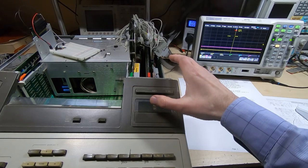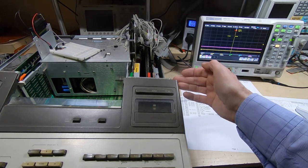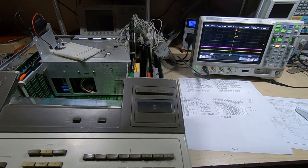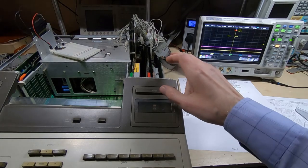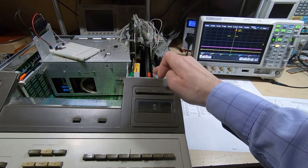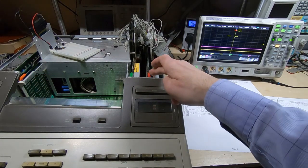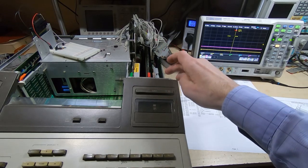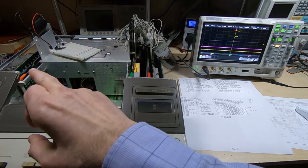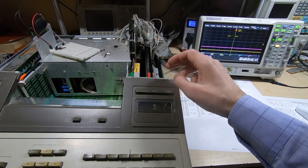In this video we'll see what is going on and try to figure out exactly what's causing the boot failure. There are other faults I know about, but none that should stop the system from at least initially going through the boot-up phase. Just to recap on the way this machine boots up: we have the two processors, the LPU on the right and the PPU on the left. Each has its own ROM and RAM card, but during the initial boot-up both of them use the ROM in block 5, which is on the PPU ROM card.